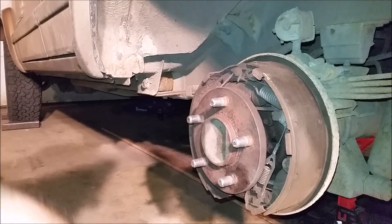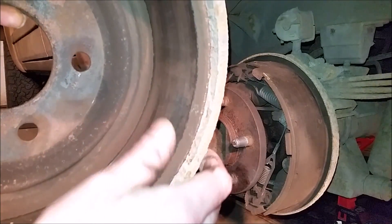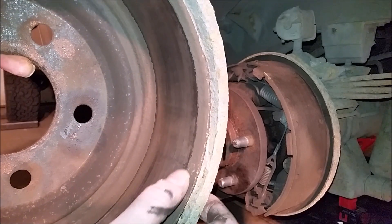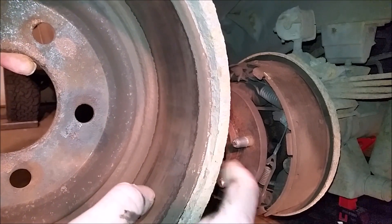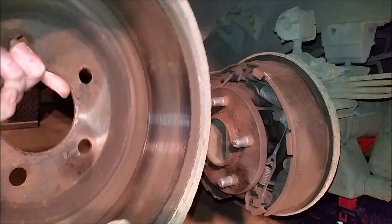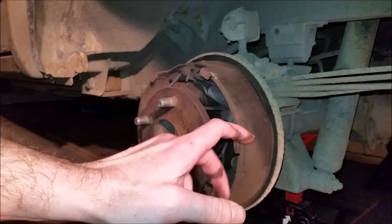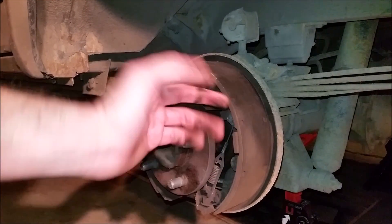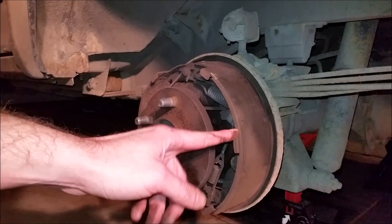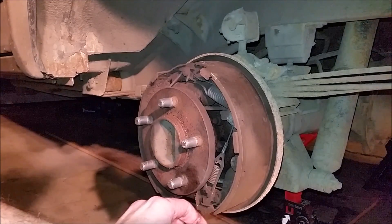Once you've got your drum off, it's a good idea to have a look inside it. Make sure there's no deep scoring. Feel the edge — there shouldn't be a huge difference between the outer edge and the inside. If there is, you're probably worn out too far and you might want to consider finding some replacements. You could probably get a good set from the junkyard. I'm actually surprised — at least two or three years ago I checked these and I swear there was just as much meat left on them. They're clearly very old and after many Canadian winters these springs are looking a little rough.